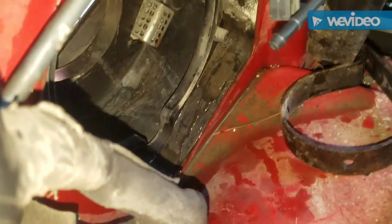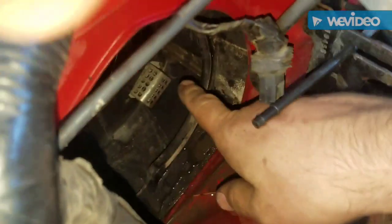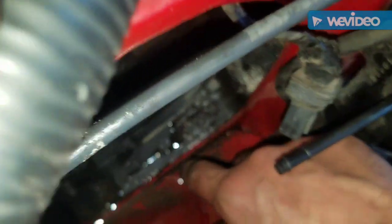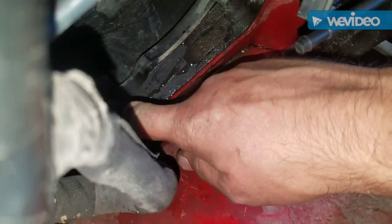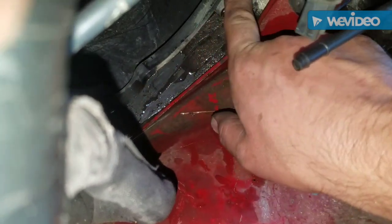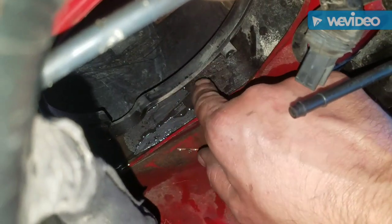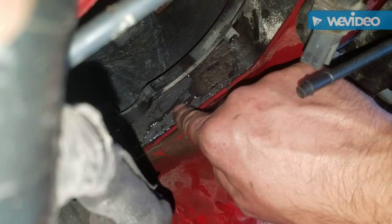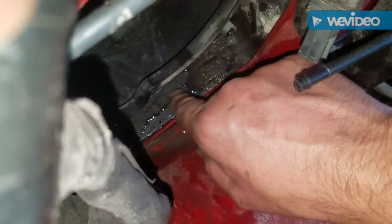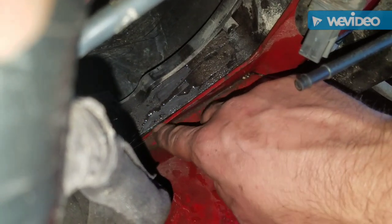So then the question becomes, how do we fix it? Well, in order to properly change that gasket, you got to take the whole heater box and the dash out. So we're not going to do that. I think what I'm going to try is seal this up with some heavy-duty lap silicone or lap sealant of some sort, because the blower motor actually sits right here and goes in that channel, so no water is getting through the blower motor, but it's settling right here. And I don't know how it's getting in this area, but I'm going to seal this up somehow. Probably not today, though.